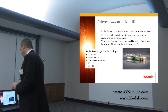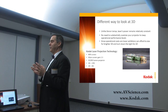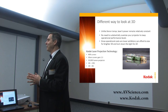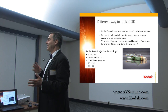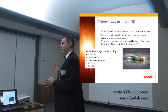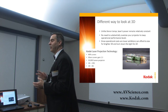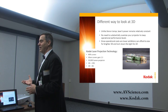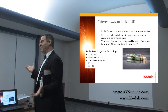There's more to it than those efficiency numbers. It comes down to how you think about projectors from the beginning — you size a projector for the lamp drop-off. If you take that lamp drop-off away, you can look at the whole thing differently. We don't need to oversize very much because lasers don't drop off much. Since operational costs are lower and equipment costs are similar, we trade off lower optics costs — as you saw from the lenses and prisms — and put that money savings toward the lasers, and the costs roughly balance out.